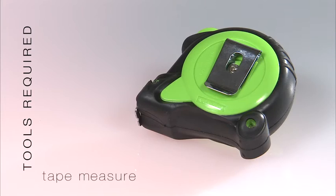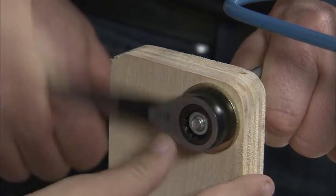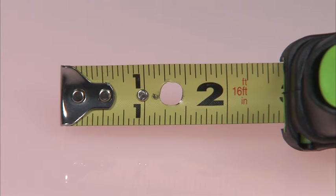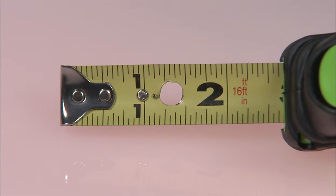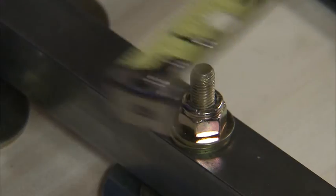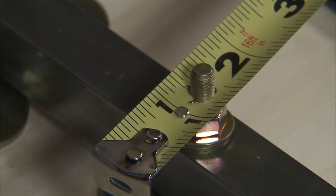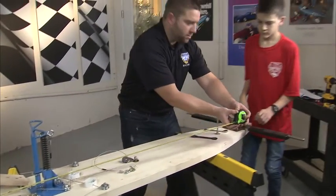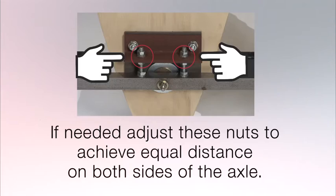Here's how you use a tape measure to do your triangulation. You'll have to remove the brake pedal cable since it'll be in the way of the tape measure. Drill a quarter inch hole near the end of the tape measure. Take off the first nut only of the front axle kingpin. Slide the quarter inch hole end of the tape measure over the front axle kingpin. Slide out the tape measure to compare the measurements of the right and left sides of the rear axle. When both sides are equal distances, the axle is aligned.